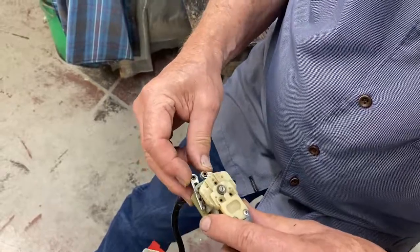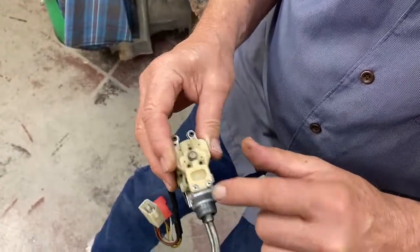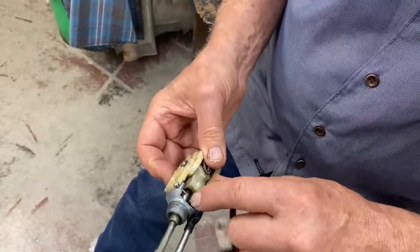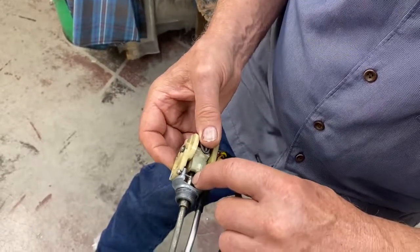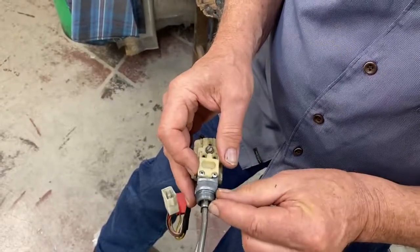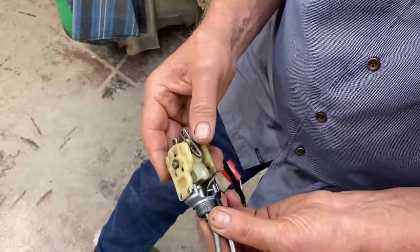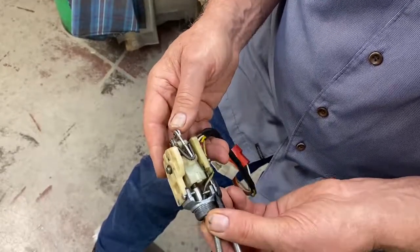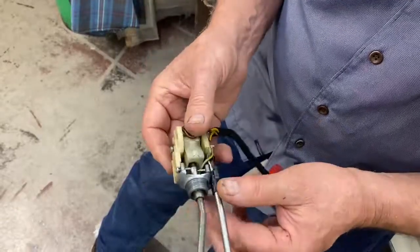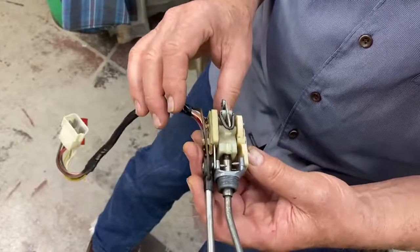They are really stiff. I think that by stabilizing the carrier assembly, stabilizing the concentricity of the piston, and by pinning the switch to the arbor here without damaging any wiring or anything else, we'll have a much more solid activating switch. I think all of these things should be addressed, and I'll put that together in an estimate and send it to you in an email along with this video.